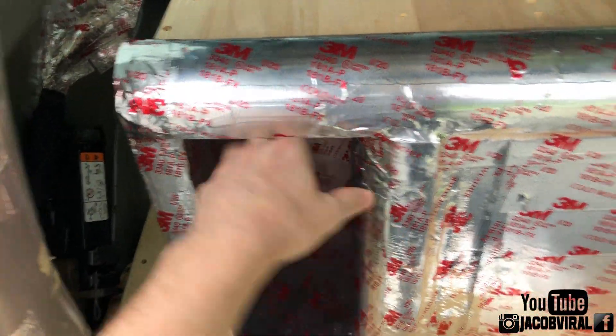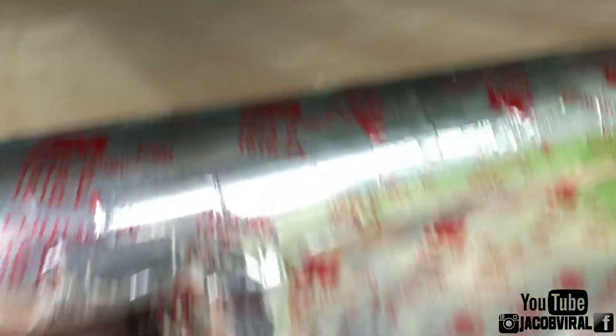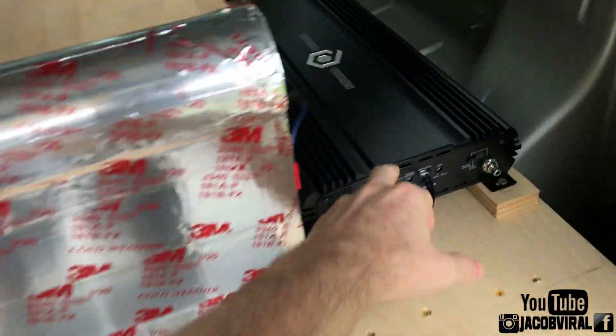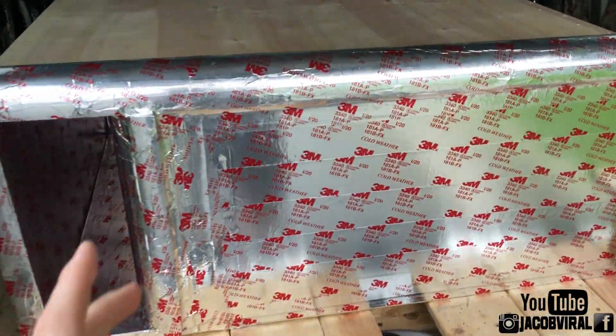Tweaking the port area — making it smaller to play better lows. Changing the subwoofer to a different type of 10 inch. Some people even suggested putting an 18 or a 15 in the box instead. I've had people suggest changing amps, mounting it back regular, putting the subwoofer back into the sealed section, and also changing the ratio — right now it's around a six-to-one, five-and-a-half-to-one — changing it to a two-and-a-half-to-one or three-to-one. That ratio change is possible and will be tested in a coming video.